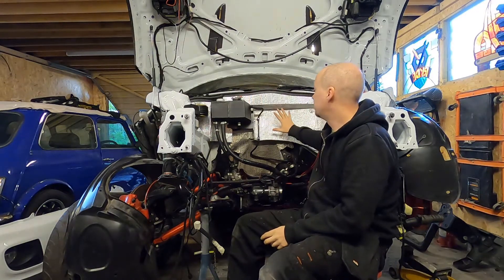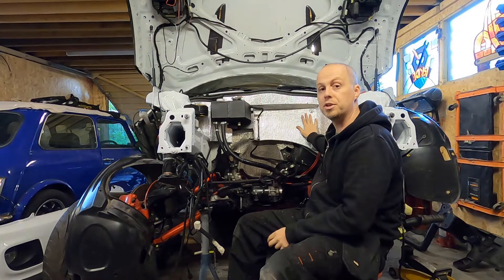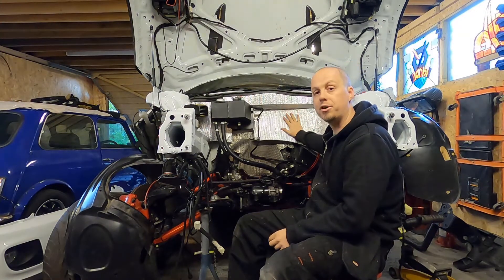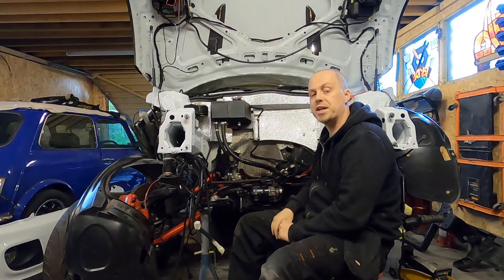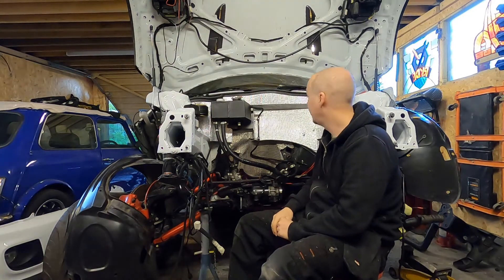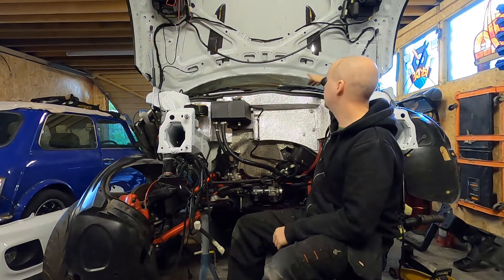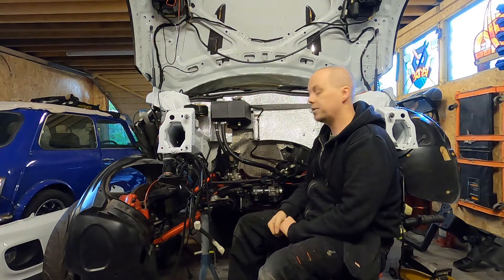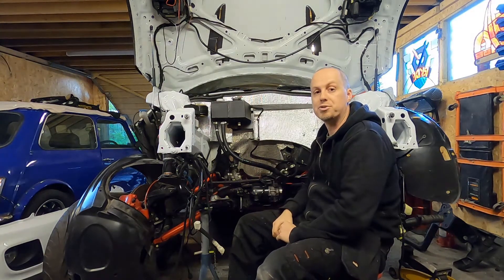So I've opted to build myself a new firewall. A lot of people don't — they just put some heat shielding across the front — but my option is 1mm aluminium plate with fibreglass heat shielding and a full firewall all the way across. That helps to protect the brake lines, the wiring loom behind there, and it also means the air I'm pulling in for ventilation is through these scuttle panels up here, so I'm getting clean air — not air that's been past the engine that might have oil fumes or petrol fumes in it.